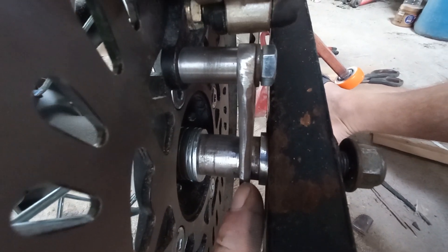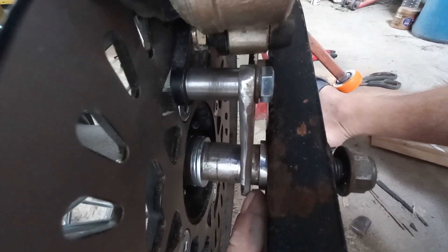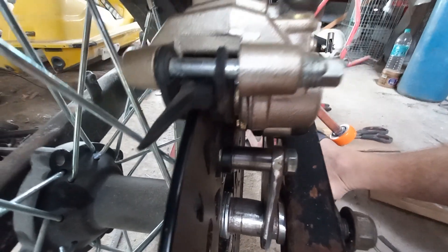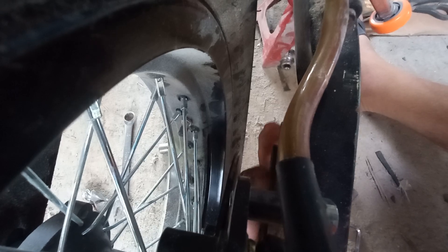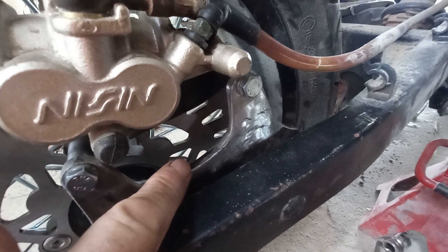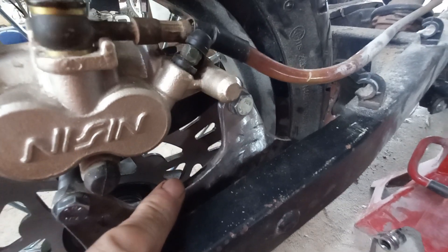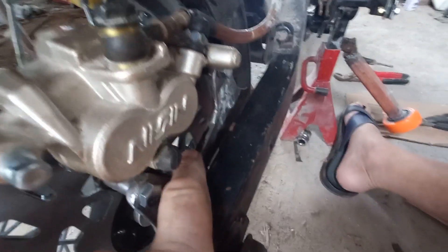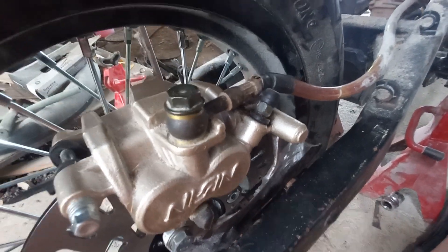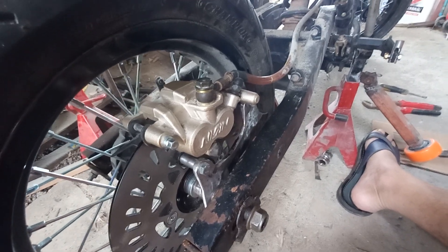Also I've got to cut this off of the spacer. It used to sit on that gap there, and now I've got to sit it inboard more, just because I didn't want a massive spacer out there. And more importantly, down here where you can just see my finger — that's the locating lug for the front of the carrier, so it doesn't spin around with the wheel. That is as inboard as it can go on that pin before falling off. So now what I'm going to have to do is weld a five mil strip on the inside of each side, just to make that five mil wider.